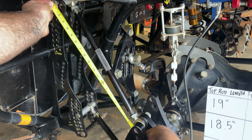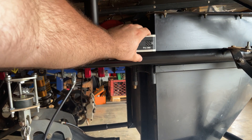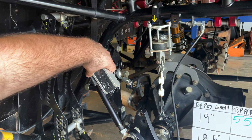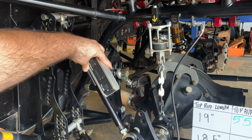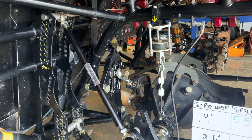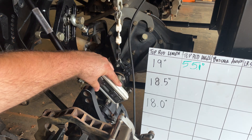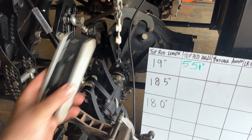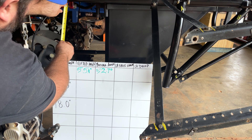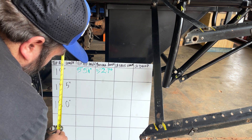We're checking center-to-center. We're going to start at 19 inches, which is where we're at. I'll zero my inclinometer on our frame rail as our zero point. With the bar at 19 inches, our top rod angle is 55.1. Now getting the birdcage angle on this face — 52.7. Now we'll get our center-to-center on our left rear behind shock — 24 and an eighth.